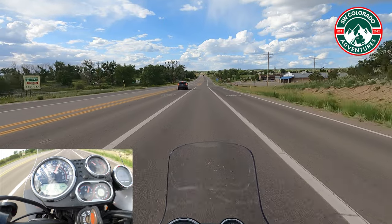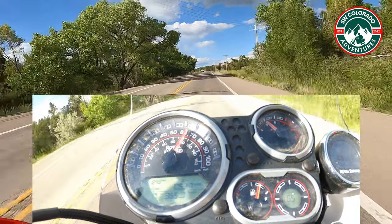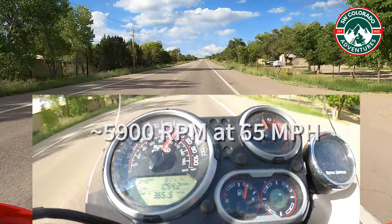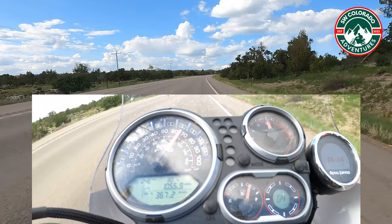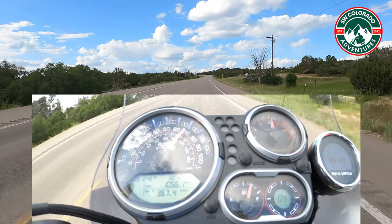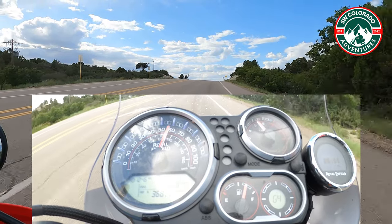Even just that — 55 to 60 uphill in fifth gear was a struggle pre-cam with a 15-tooth sprocket. Just under 65. We're going to downshift. Still under 6,000 RPM and we're accelerating, and now we're over 65. So this is a fourth gear road. This is about the top of that hill — that's my nemesis. And you'll see that in fourth gear, G4 in the bottom right-hand corner, we're at 65, actually just over. So that's a win, big time. I've still got a lot of range in fourth gear, so that's nice to know that when I downshift, I've still got something I can work with.